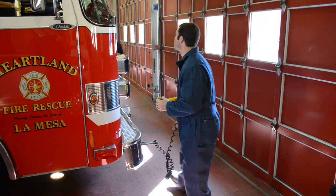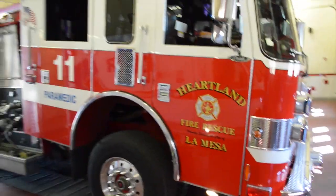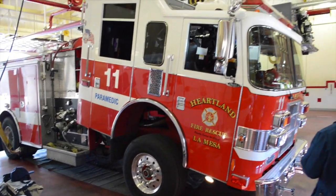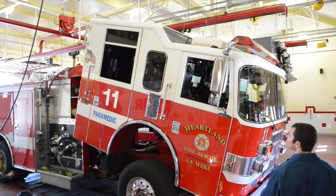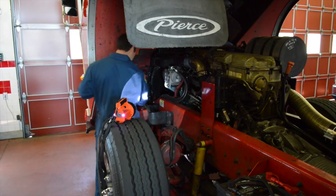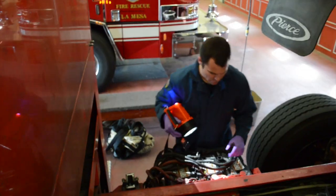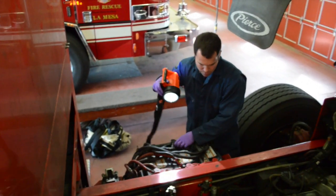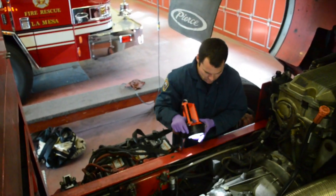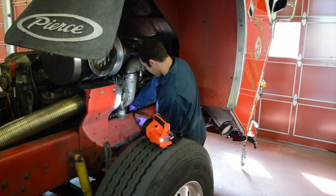Once the brake inspection is done, the engineer will secure all of the equipment inside the cab and tilt the cab for inspection of the engine compartment and the undercarriage. In the engine compartment, you are going to check for leaks and unusual conditions. You will check mechanical components such as the air compressor, the alternator, batteries, belts, the frame, hoses, slack adjusters and brake chambers, the steering box, and the water pump.